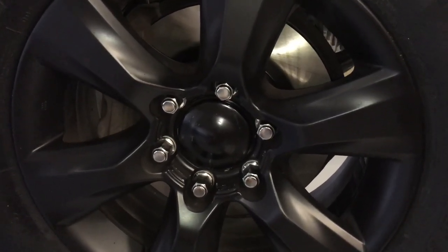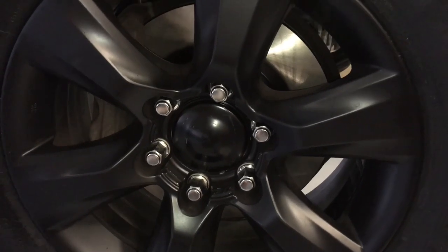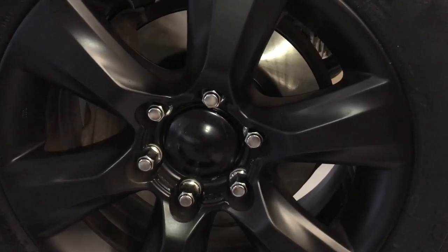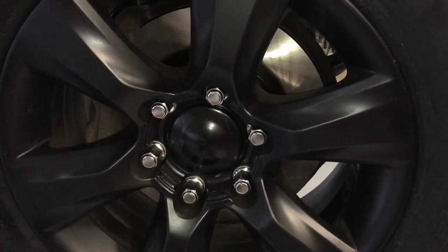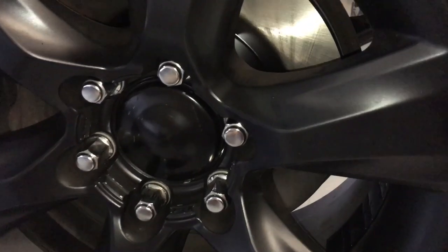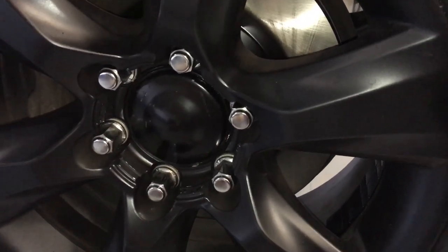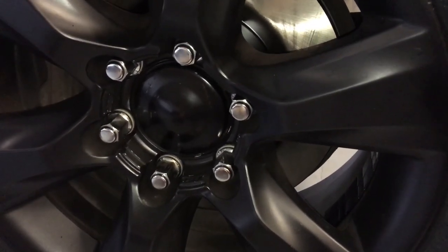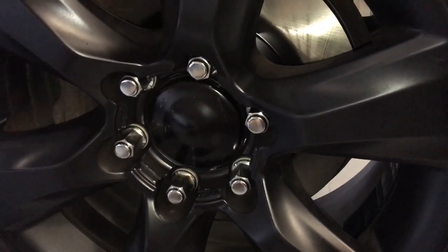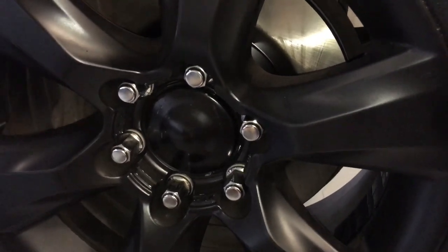This is a Toyota so it's going to be fine — the calipers usually work fine. But you can get a little nick in the dust boot from people changing their pads, and then dust and dirt gets in, dries it up, and one of the pistons becomes a bit lazy, moves a bit slow, or seizes up. You get tight brakes and pads sticking on — there's your problem.